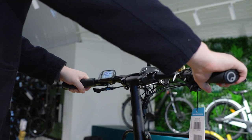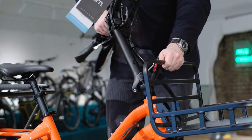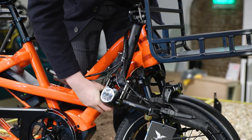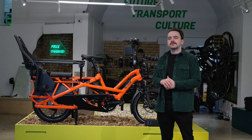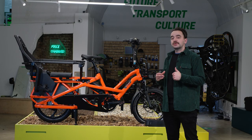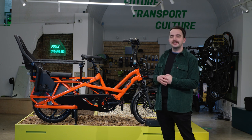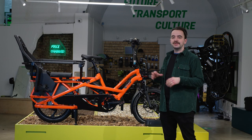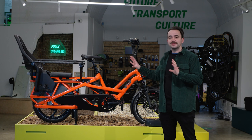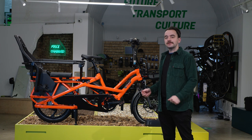The GSD is designed to fit a range of rider heights and has a few key adjustable features. The handlebars are adjustable for a more sporty or more upright riding position. You can also collapse the handlebars and stem: push the red button up and push the black lever forward. To put the handlebar down, turn the wheel clockwise, then secure using the strap connecting to the knob. For front-loading cargo, you can have the transporter front rack or the hauler rack. All GSD models come with a rear kickstand — super stable and strong. When ready to set off, press the lever on the left handlebar; to engage the kickstand, push down with your foot and roll the bike back.